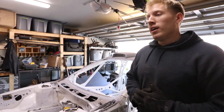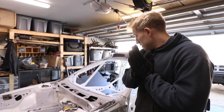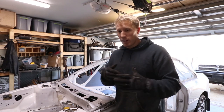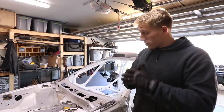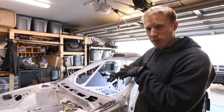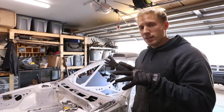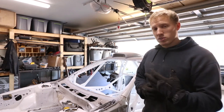Anyway, we got a long list of things to get done today. First step is going to be mounting the hydro — I made the hydro a couple days ago in that video. Then I'm going to run the brake line to the rear brakes, then to the proportioning valve, then from the proportioning valve up to the front brakes. We might hold off on going from the proportioning valve to the master cylinder until tomorrow when I start working on wiring.